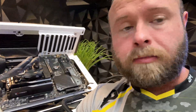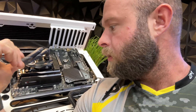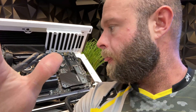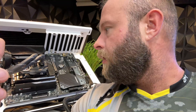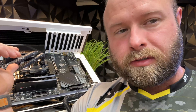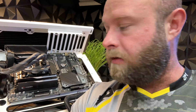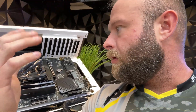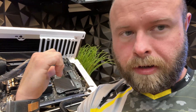So this thing is turning out to be nothing but a nightmare. Yellow DRAM light, error light on the motherboard, red CPU light — same exact problem that was on the previous motherboard. So obviously the problem is in the RAM or the CPU. I read somewhere that maybe over-tensioning the cooler could cause a problem with the processor. The RAM seated fine and I let it sit for a while. My next step is to put the old cooler back on. I tried a different power supply — that didn't work either.